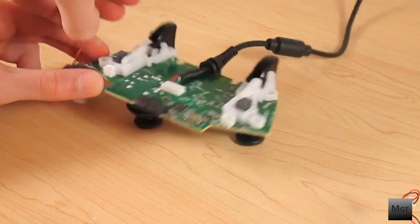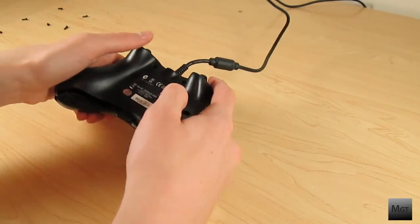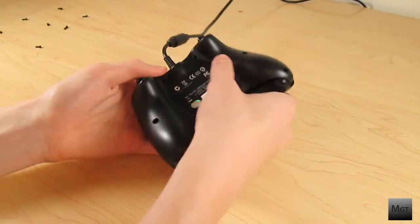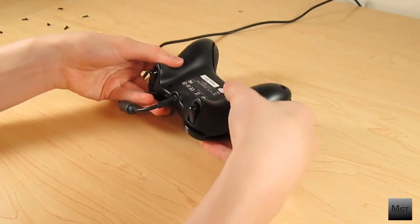It should unplug just like a computer fan but it could take a bit more tugging. If your controller is wired you will have to jimmy the wired part back into place to sit in between the shell and the logic board. If the bumpers came out you will need to make sure the holes go over the screw holes before you put the logic board back on.